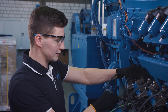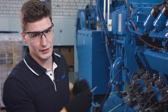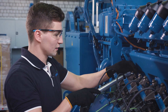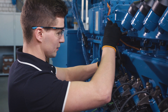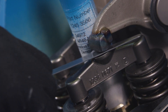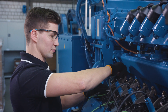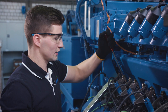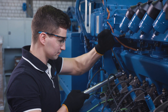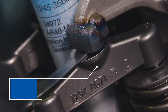The exhaust valve should have a valve clearance of 0.7 millimeters. This is definitely too small, so let's loosen the check nut. Now we turn the setting screw out a little bit until our thickness gauge fits in comfortably. Then we fasten it so that we can still easily move it to and fro, and then block the check nut slightly. We hold the setting screw with the screwdriver and fasten the check nut with 45 Nm. Another check — everything okay.